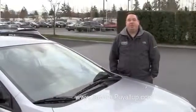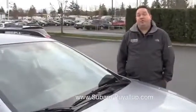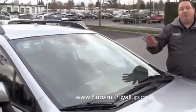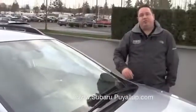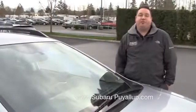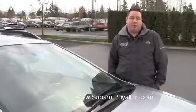There are some quick, easy telltale signs if you need wiper blades, especially for our nice moist climate here in Washington State. Streaking on the windshield, any type of noise and chattering is a sure sign that you're going to need to replace your blades. Generally your blades last one season, so you're probably going to replace them at least once a year.